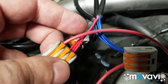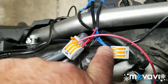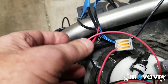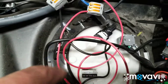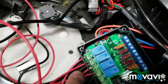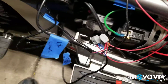Those three small wires — I twisted all three together: the red, the blue, and the black. The blue wires are running lights, the red wires are the turn signals, and the black wires are the ground. Then I fed them with another piece of wire — I didn't have any blue so I used a piece of red — and ran those over to the terminals here. That's how I wired this up, right side and left side.